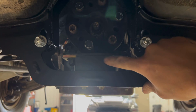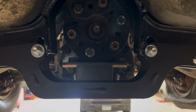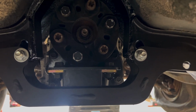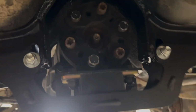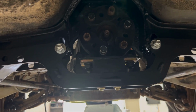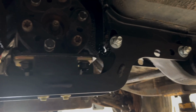Back in the day, they made a short Chevy mount, and I know Energy Suspension still makes one, but at the end, I sat there and thought about it. I'm like, maybe I should just order one. But I would have only gained like 1/4 of an inch, and the tranny, the angle and everything sat a lot nicer at about 1/2 inch, 5/8 down. So I'm glad I moved the holes. It just was quite a process for something that I bought to be bolt in. That was the biggest thing. I bought all the Holley stuff to be bolt in.